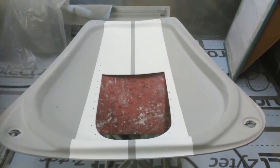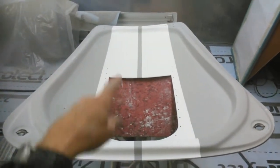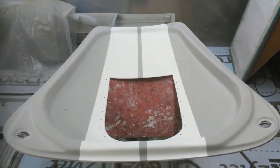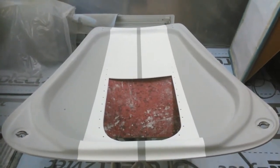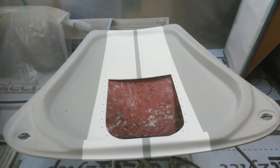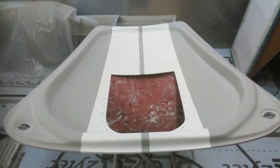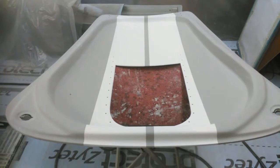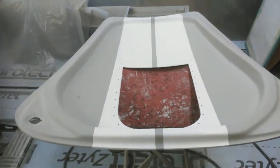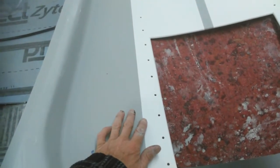I've started painting some of the actual color on the car. I've done some of the white inside the Le Mans roof and put some stripes up the inside of the bonnet. It's actually a white top coat, and I've wet-sanded it back after 24 hours and flatted it off again. Now I can mask that off and paint the blue next to it either side and down the middle.